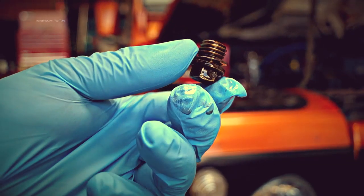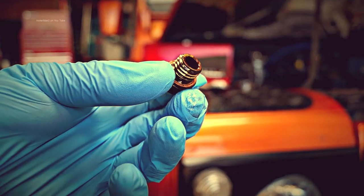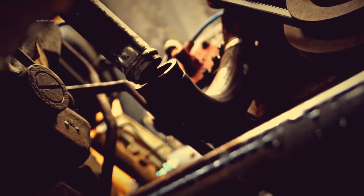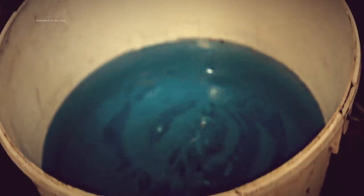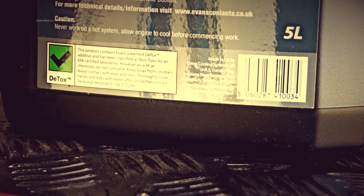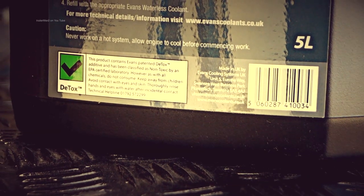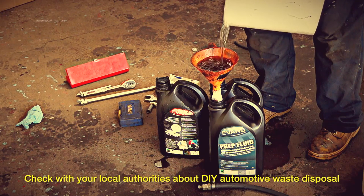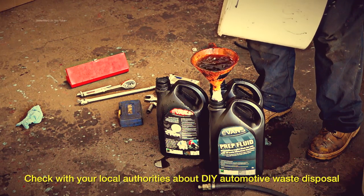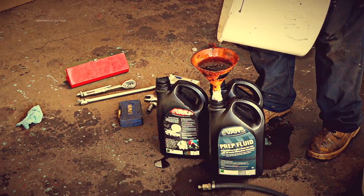Same process — what we're doing is making sure we've got as much of this flushing fluid out as possible. This is almost the same as the solution that's going in, but we're draining it out as much as we can get out. The prep fluid is actually non-toxic; however, if you're going to dispose of it, because it will have antifreeze in it, it needs to go to a waste site — you'll have to contact your local county council about this. We've also got a little bit of cleaning up to do in the pit because it can be a messy job draining out.